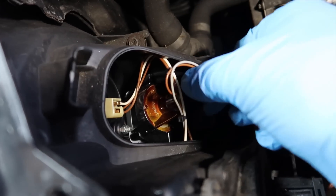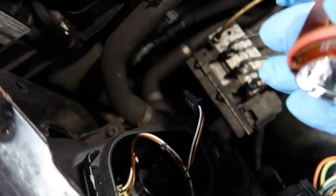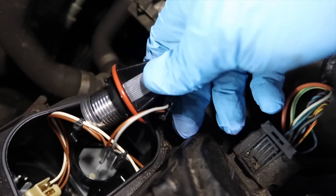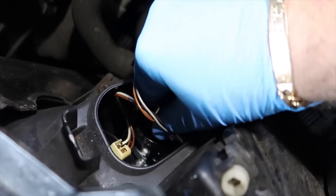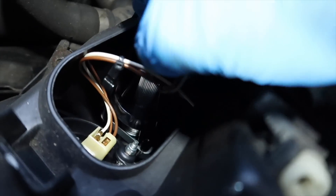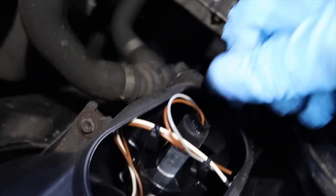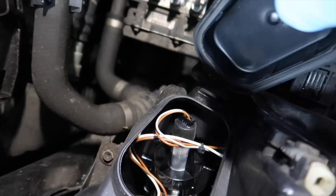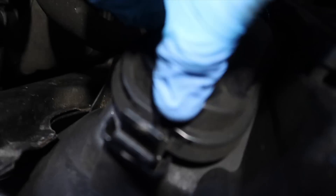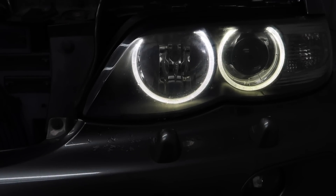For this side it's the same thing — turn the old bulb out, take it out, then unplug the connector. Now we're going to fit the other LED bulb. Align it — you'll see the three dots here, look on the bulb and find where they all are, put the bulb in position, align up all the marks, and when you feel it pop in, give it a turn to lock it in. Get your original connector and plug it onto the LED itself. That's all done — the bulb is locked in. Get your cap, push it back, and snap the tab up so it locks in place. The job's done and we now have white halo rings on both sides.